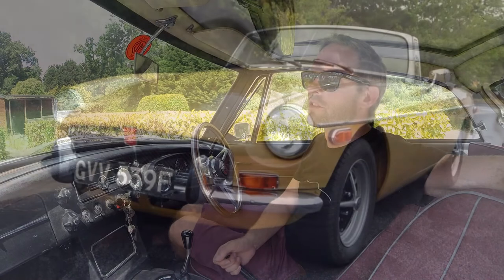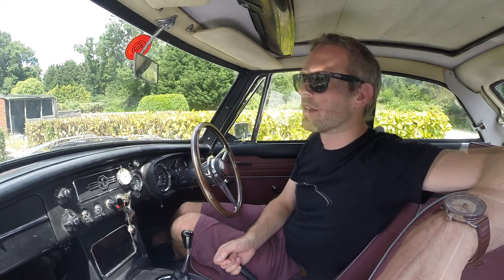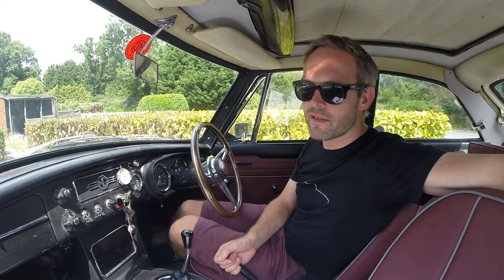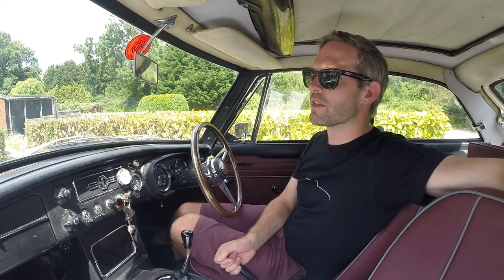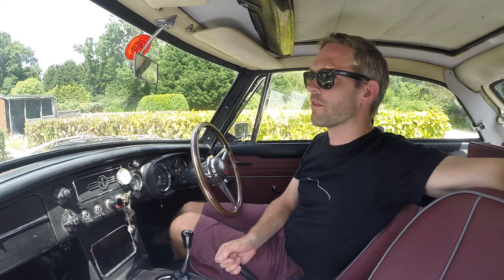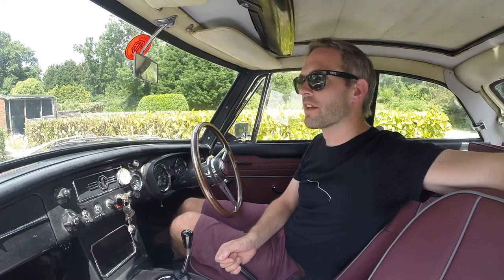In October 1972 the MGB converted back to a more traditional radiator grille, but instead of chrome slats it now had a black honeycomb mesh — quite a nice combination of old and new that looks quite sporty. However, not everything was sporty about this variant. In most markets power remained unchanged, but for North America, due to tightening emission regulations, the power had actually dropped from around 90 horsepower down to around 70, running on a single carburettor, which made them pretty dismal in terms of performance. Many American owners have since upgraded to the standard twin SUs from other markets.